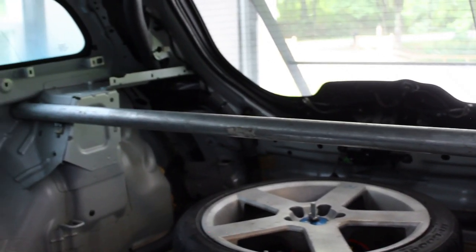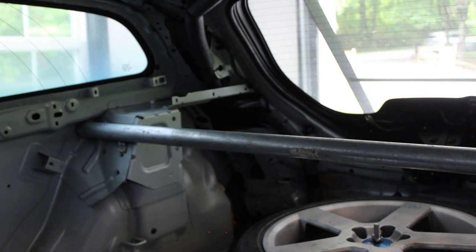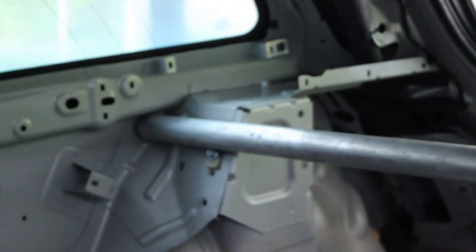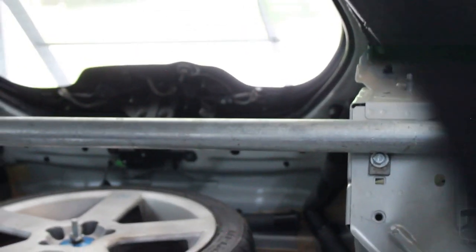So that's underneath the car, but now let's talk about an upper rear strut bar. While not necessarily a true strut bar — more of a stabilizer bar — we have the Belgian brace, which is a product that is now sold by Elevate. They have a fixed option and a removable option. As far as I know, there are no other companies currently offering this type of rear stabilizer bar. The idea is that it basically helps connect this tubular vehicle by just giving it some support in the middle. I have to say that this bar might have made a bigger handling difference than the rear sway bar did. This bar is literally nothing more than a bar that runs between the bolt points for the back rest of the seats — a very secure spot, and it's pretty close to the top of the rear strut, so people usually call this a rear strut bar.